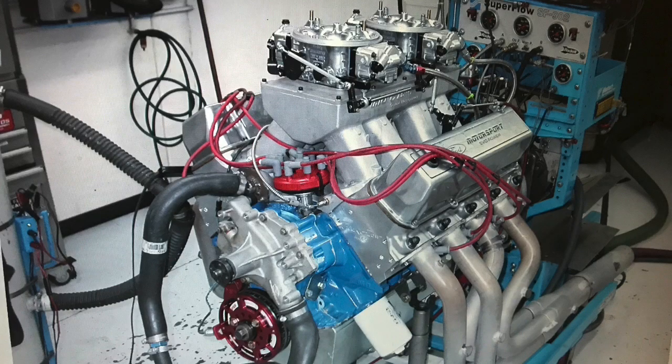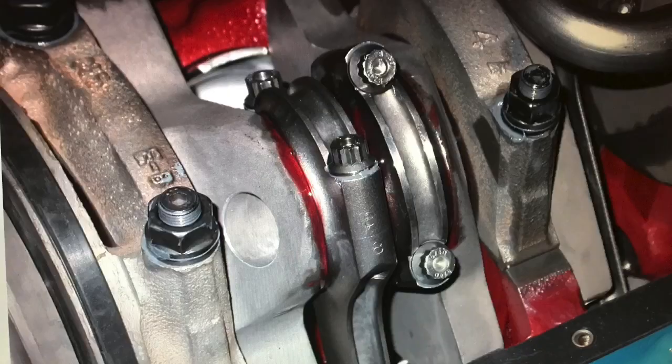Okay, guys, what do you think about the test on our big block stroker Ford? Personally, I thought it was awesome. That's the most power I've ever made on a big block Ford on a 460 base deal, and I thought it was pretty cool. There were a lot of good things about this. I was impressed that you could use that stock 2-bolt block and go out as big as we could go, making it 557 inches. Obviously you can't do that with a production big block Chevy block, which is cool, and all the Ford guys get to rub it in their face.